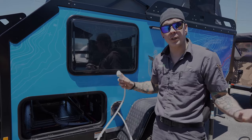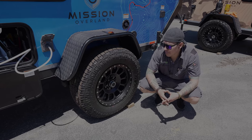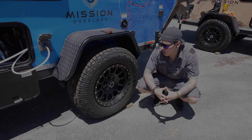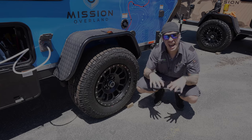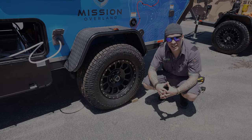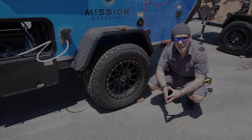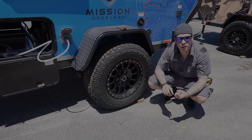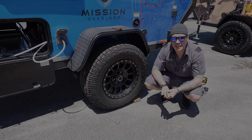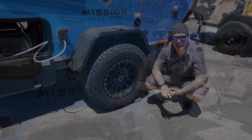Here at the wheel we're going to talk about lug nut torque and tire pressure. With any camper tire, we want to run those at maximum tire pressure when on the road. If you're doing serious off-roading, you may air down to accommodate that. This unit has independent suspension and is equipped with Dexter hubs. Most manufacturers recommend re-torquing lugs at the initial 15, 25, 50, and 100 miles of your first travel, and then at the start of each trip. Torque those down to 100 foot-pounds and make sure they maintain that level.